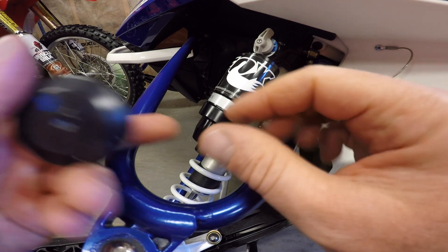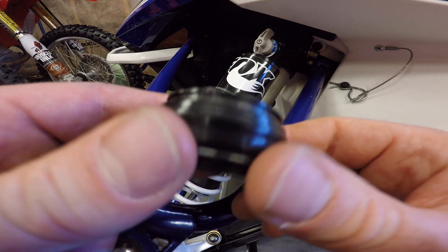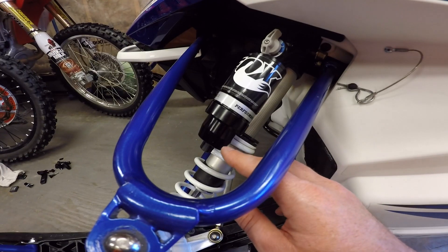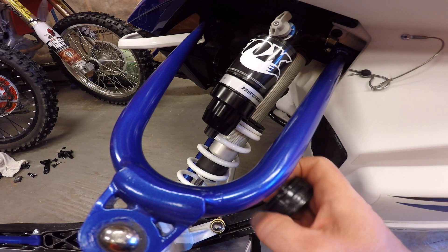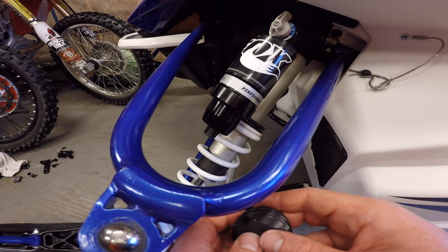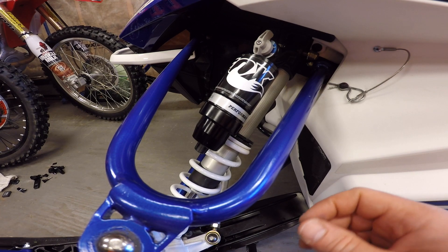What happens with the little rubber pellet is that it gradually leaks pressure through it. So I did some shopping around online and some digging, and I found these — they're actually higher-capacity end caps. What they have on them is an actual Schrader valve — a high-pressure, high-temperature Schrader valve. With that Schrader valve, it holds the pressure a lot better for a longer period of time, so you don't end up with your shocks fading out.